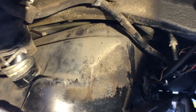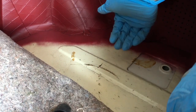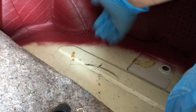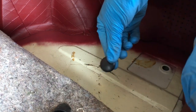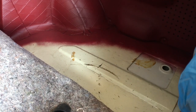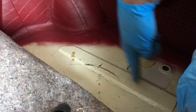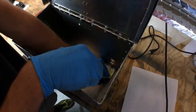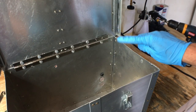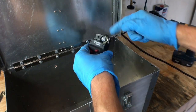This is the indent of the floorboard that I want to drill into — that way I can sight it easily from below, and more importantly it's raised so a washer and nut can sit hidden inside there, keeping them away from the gas tank. This spot with the little rubber gasket is where we're going to drill through to run the vent line for the battery. We'll line up the battery box, mark our holes, drill through the box, then drill through the floor. The holes for the circuit breaker will mount up here — the line comes in to the bottom of the circuit breaker and the top goes out to the battery.